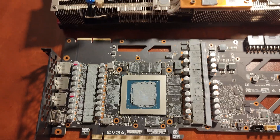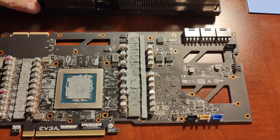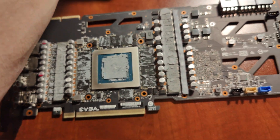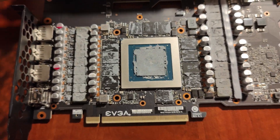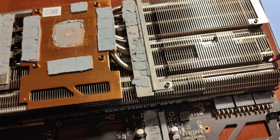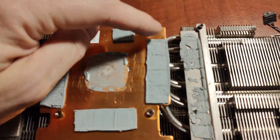Now the card has been taken apart — all I had to do was pull the card apart; all the bolts and nuts are already loose. We can see that the card thermopads, like over here, are pretty dry. This card was used for about six months, and I already see a big change in the quality of the thermopad. You can see that it's ripping — I touch it and it feels pretty dry. This actual VRAM part where the 12 chips are, the VRAM is fine.